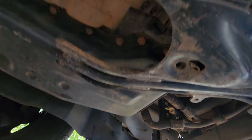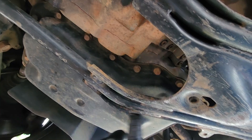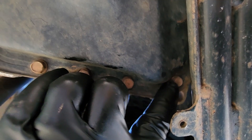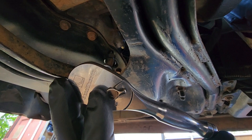Got all the plastic stuff out of the way. You can see where this is broken on mine, but there was a bolt right through here. The next thing is going around and loosening all the 10 millimeter head bolts that go around the transmission pan. These two look like the only tricky ones — there's one behind here and one tucked in right here. I'll have to use a universal.